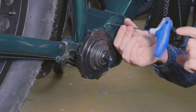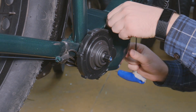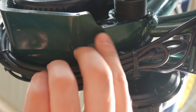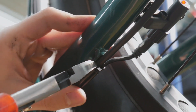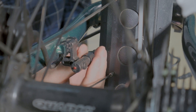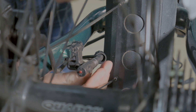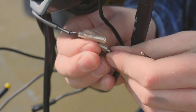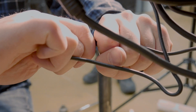Now, remove the drive side motor cover. Your bike may have wires zip-tied under the motor casing — you can snip the ties with the side cutters. With the zip ties cut, the speed sensor can be unplugged. Unscrew the weatherproof connector and unplug the sensor. The other motor connectors can be unplugged as well. If the connector is very tight, pressure can be applied sideways to slowly work the connector apart.